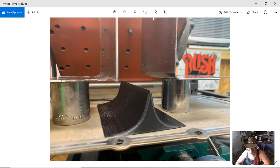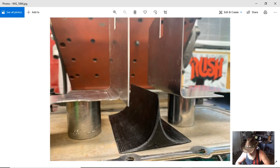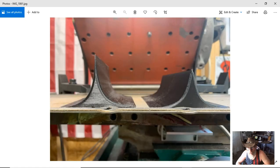And the second thing it's done is it's also allowing the front cylinders and the back cylinders that are pulling air for scavenging to go across the top of the lip of the wedge, which can help in higher RPM settings. So anyway, let's see if I got any better pictures. There's the big difference between the two right there. You can see that it's 0.75 taller on a Stage 1 compared to a Stage 2.